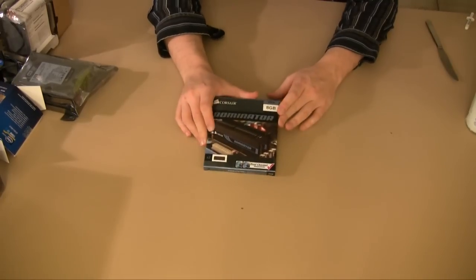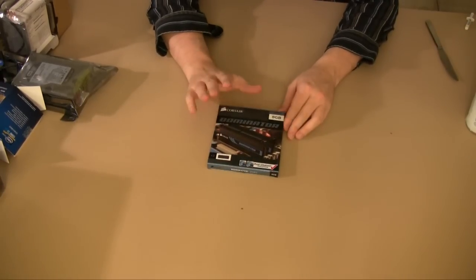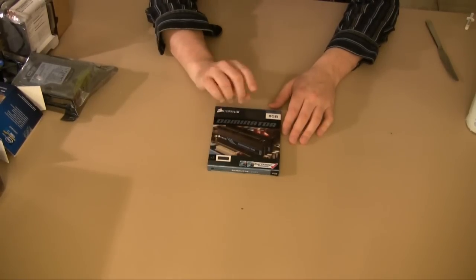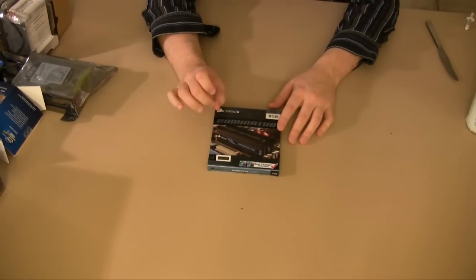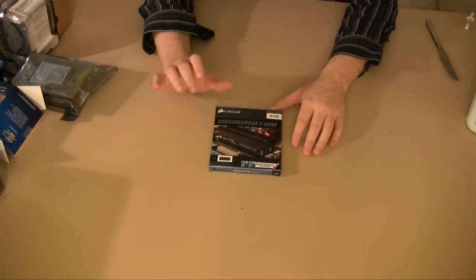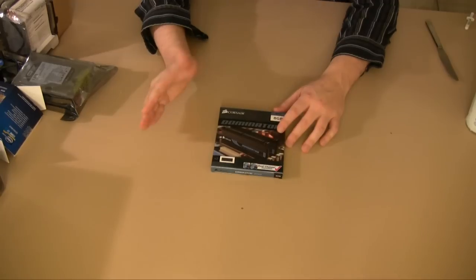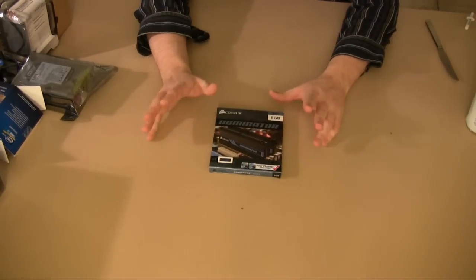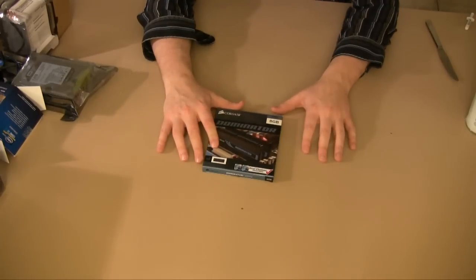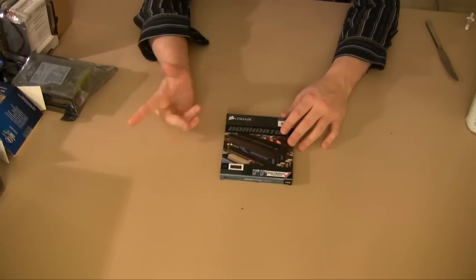They pointed out that error because what I would have gotten is some RAM that just wouldn't have worked. So I've got eight gigabytes of dual-channel RAM, which is twice as much as I've got in my system now, and that should be plenty. The motherboard does have slots for four sticks, so I could go further if I wanted. But I'm running Home Premium Windows 7, which has a 12 or 16 gig limit on RAM. If you're building a system with tons of RAM and using the Home Edition of Windows 7, just be careful — there is a limit beyond which it'll just ignore the RAM. Also, if you're running 32-bit Windows your limit is four gigs because of the architecture, so if you want more than four gigs you definitely have to go 64-bit.